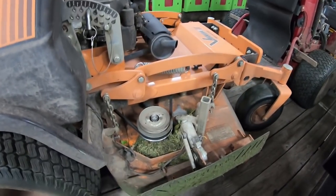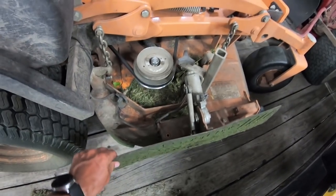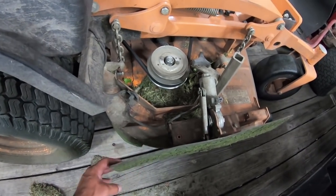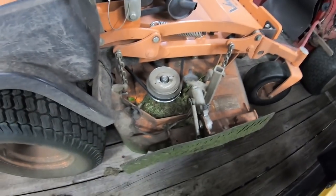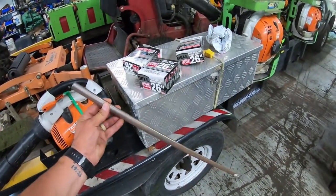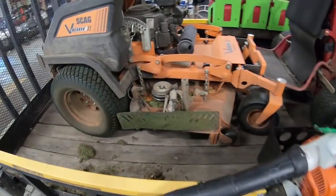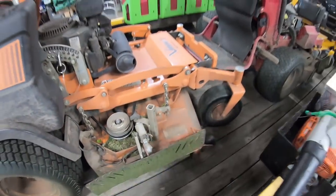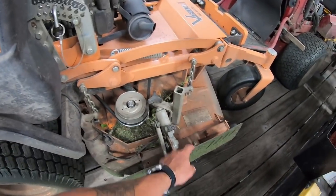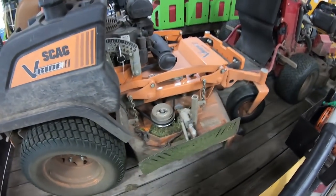But I, of course, have run into an issue. So anyway, I seen Max mowing, and I seen this thing moving up and down, and I stopped him, and I looked at it, and noticed that was gone. So at some point, that disappeared. But I do have a long stick of this tubing. So I will just take that one off, and I'll measure how long it's supposed to be, and I'll cut a new one, and then I'll get some longer bolts to come up through so I have more meat to grab onto, and I'll put lock nuts on both of them. Problem solved.